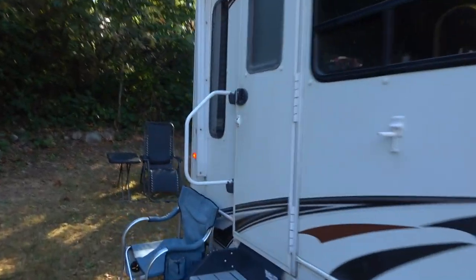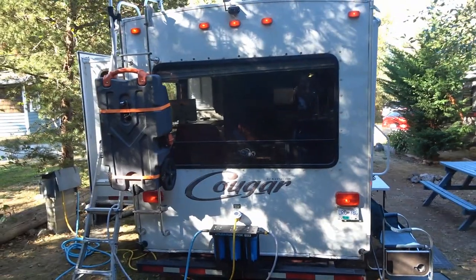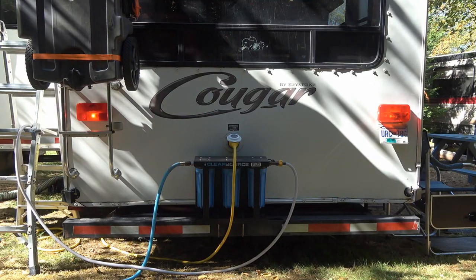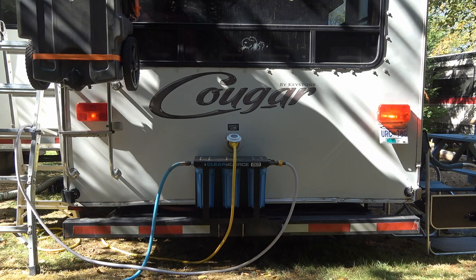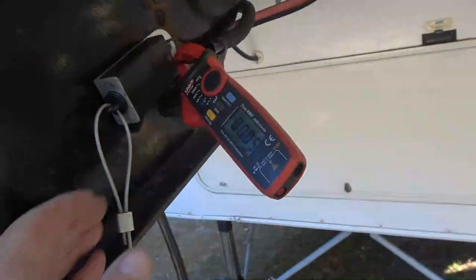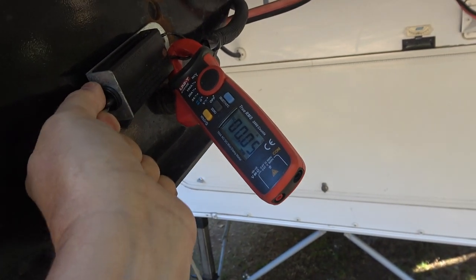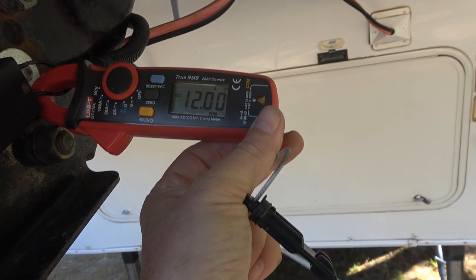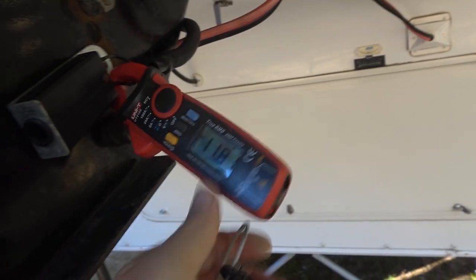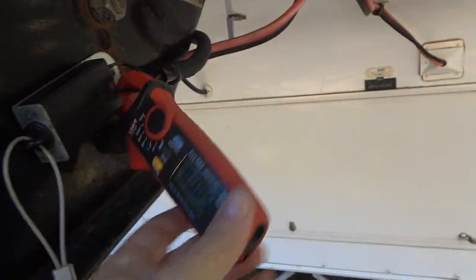Looks like she's good — lights seem to be working. Going into the truck to check the brakes and signals. Next I'll do a check of the breakaway switch. If you become disconnected from the trailer, this lanyard is supposed to pull out and slam on your brakes. You can measure the current here — it's right around 12 amps, about 3 amps per brake — so that's working right. I replaced it a couple years ago so it's still in pretty good shape.